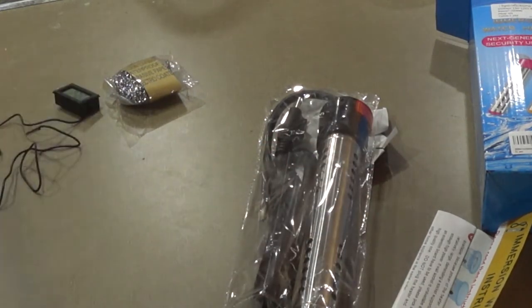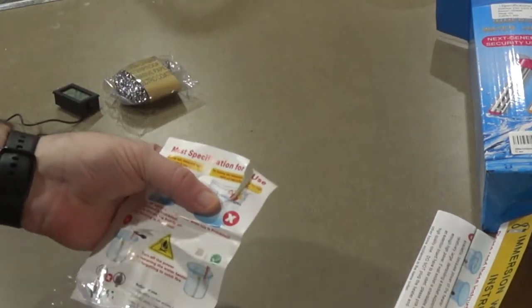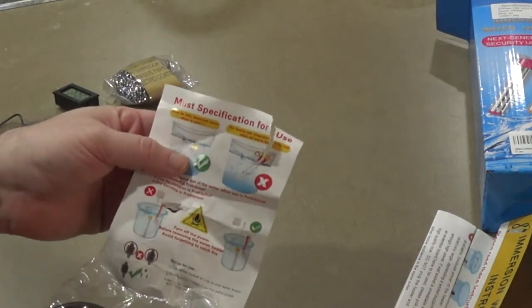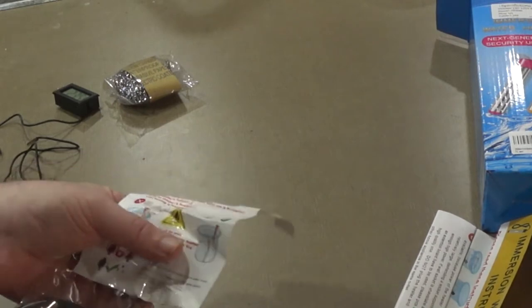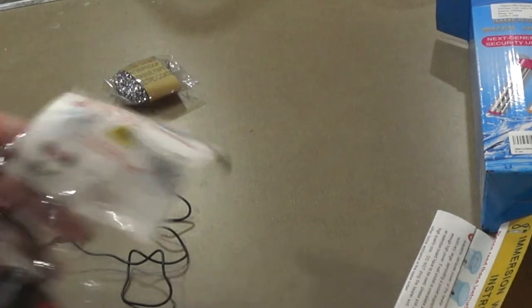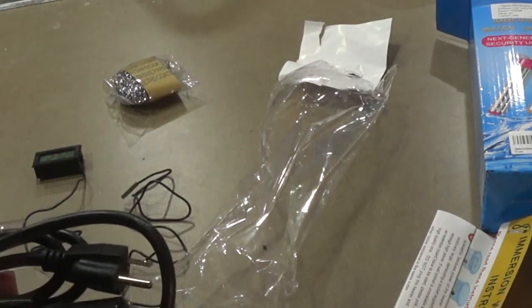There are some standard warnings here. First, make sure the heater is always fully immersed — when it's plugged in, make sure it's entirely covered by water. Don't put it in only partway. Also, don't put your hands in while it's plugged in, which is a good reason why it comes with the thermometer. It also says don't plug two into the same outlet, though I'm not sure why you'd need to, maybe if you really wanted to heat things up faster.